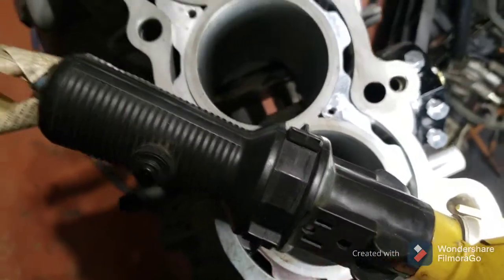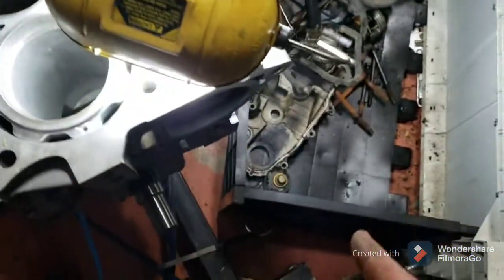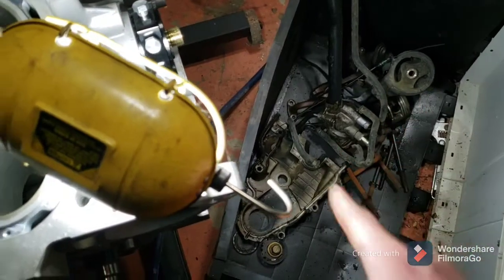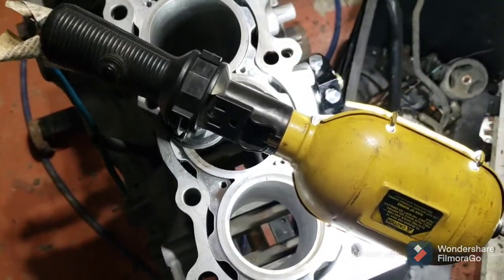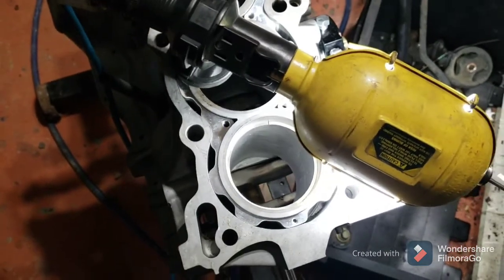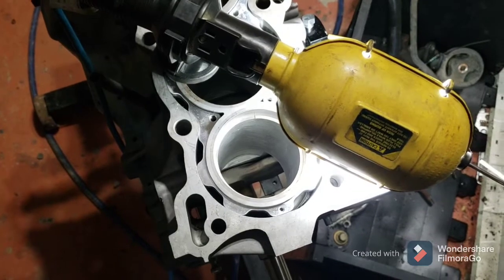That's that. The other 2 cylinders have been done. I've got the stuff laying over here. This is just a junk pile of engine stuff where I tore the motor apart originally. So now my top rings are set. I got to go through and do the second rings, which I'm not going to bother doing on video. We know most of it now.